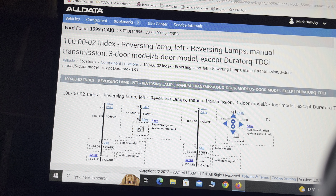Forget it — let's go back into HGS. Go to wiring diagrams, click on the edition, go to exterior lighting, go down to reverse light, three and five door. There you go — there's your reversing light. We've got the colors, the way the connector is — it's a splice in the luggage compartment — the color of the wire, another connector, tells you where everything is, and there's your reverse light switch. How easy is that? That was seconds to bring up a full wiring diagram with all the colors.